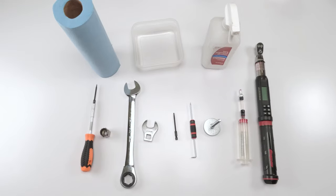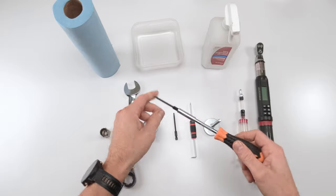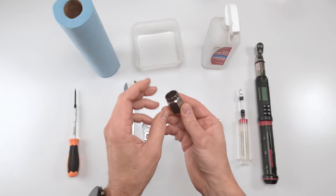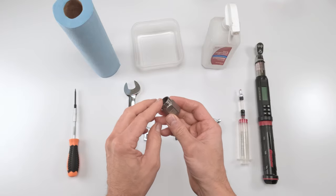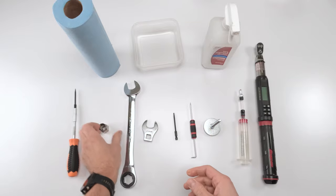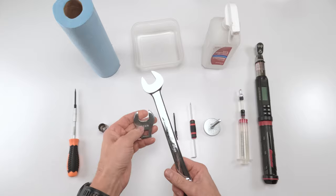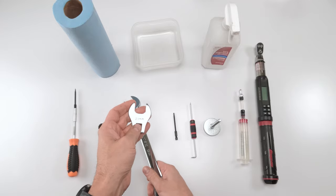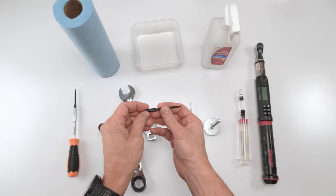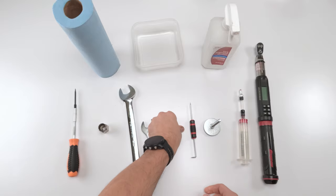And for the damper, a 2 millimeter to take out the dial bolt on top. For the air spring, I forgot to mention this, both air spring and damper are fully removable. You're going to need a cassette tool, okay? So a regular cassette tool will remove them. From there, we are going to remove the seal head: 23 millimeter wrench, 23 millimeter crow's foot to torque it back down. You're going to need a T10, Torx 10 bit, in order to take out the bleed screw.